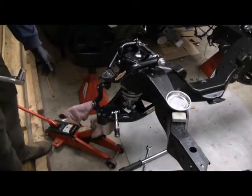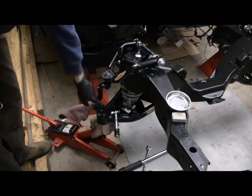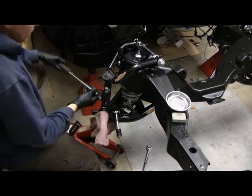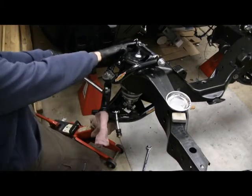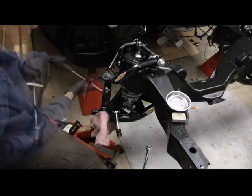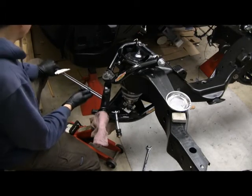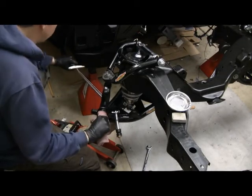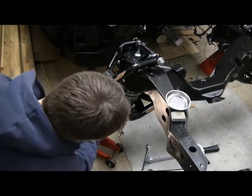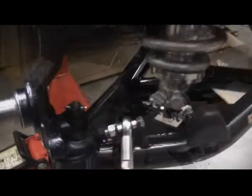For Global West, the castle nut for the upper ball joint is 60 foot-pounds and the lower is 90 foot-pounds. I've got a torque wrench set to 60 for the upper. My digital torque wrench doesn't go up to 90, so I have to use my old-fashioned beam wrench for the lower. Then put your cotter pins in once you get the castle nuts lined up. That's basically it.